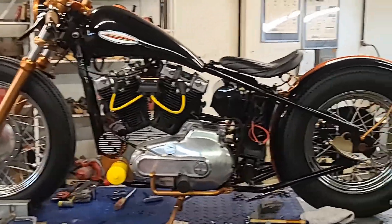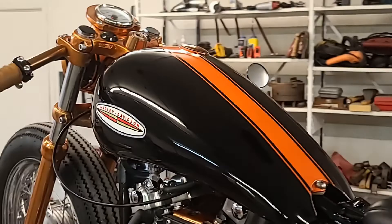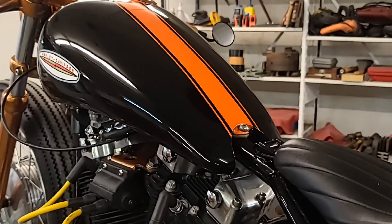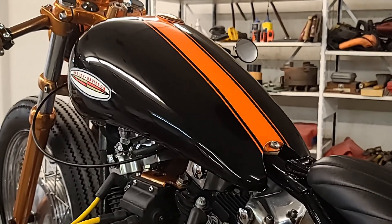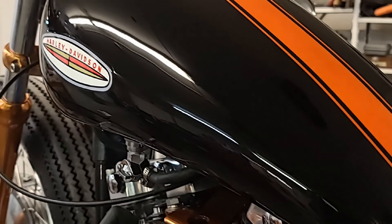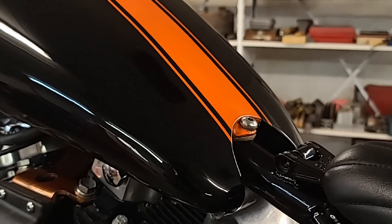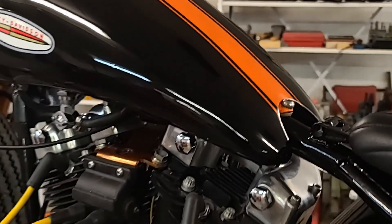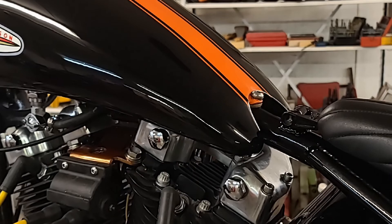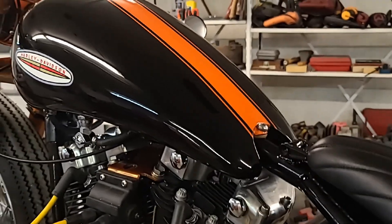It was too wide, so I did have to narrow it two inches, but that came out well — no seams, no hickeys. This is actually the second time I painted this tank. The first time the paint came out great, but I had a small fuel seep right here because I got in a rush and didn't properly pressurize the tank. I checked it for leaks but didn't put any pressure behind it, so going down the road it finally developed a leak and ruined the paint.